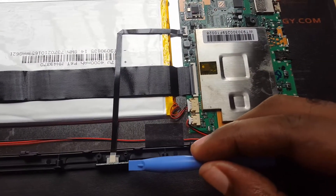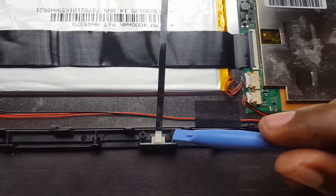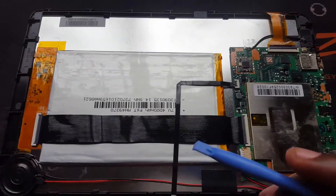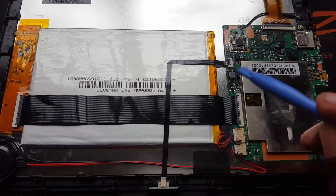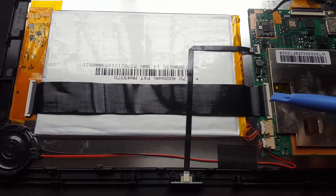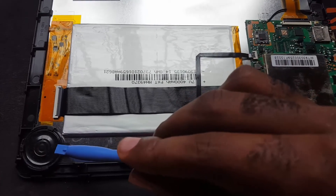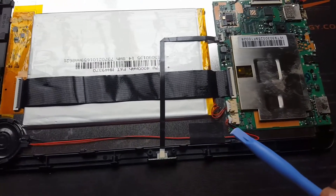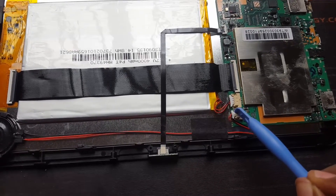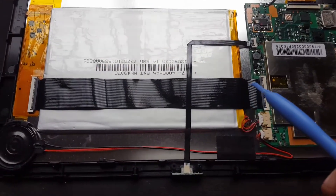Down here you have a quick connection point that's easy to change — you can find replacements on eBay or scrap an old device. To get to the battery, depending on what you're doing, you'll have to disconnect this and move it out of the way. Here is another ribbon cable connecting what looks like the camera. Down here you have the speaker, which is also changeable — follow the lead to the connector on the board, eject that section, and you'll be able to change the speaker.